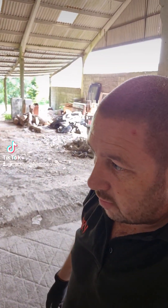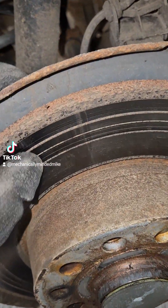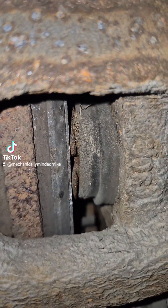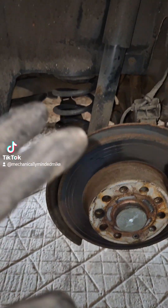Just doing an initial inspection. The customer is going to start towing this vehicle, so I want to make sure the rear pads and discs are good. Something I spotted: they are scored, but not seriously weakened. I've checked the pads on the other side as well — they are wearing evenly — so I'll tell the customer they are about 50%.